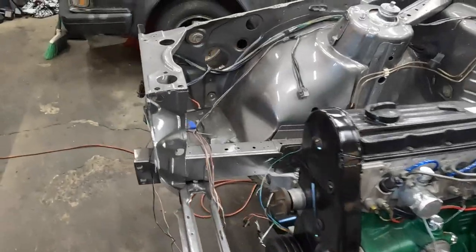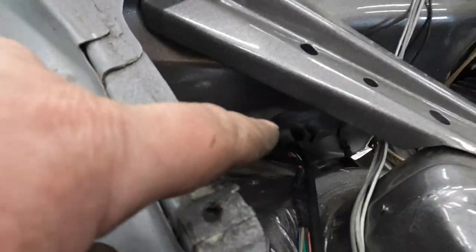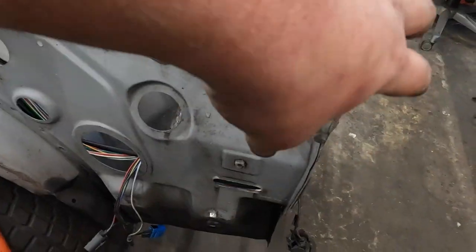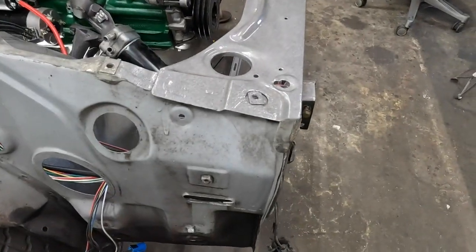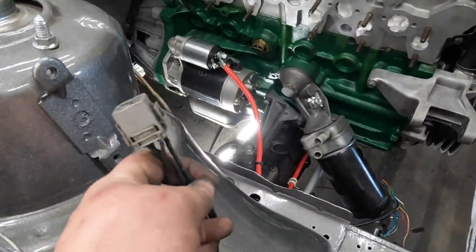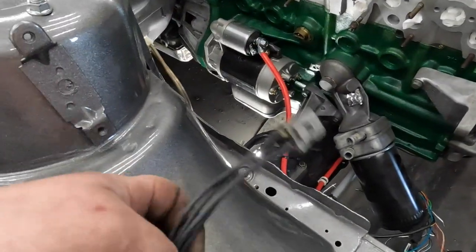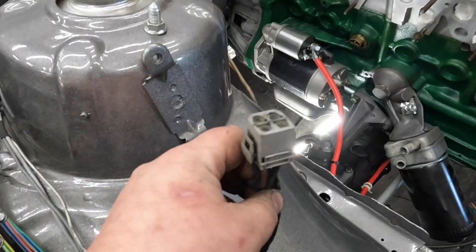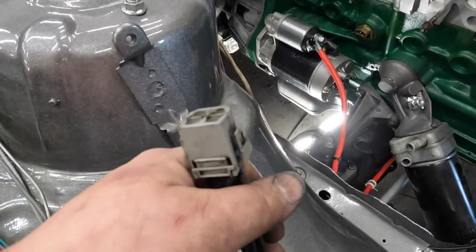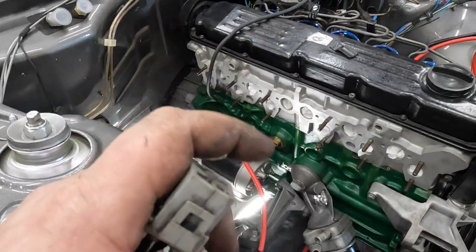The fourth harness — I can't count — uses another feed-through and comes up to give you your lights on this corner. Interesting note right here: what mounts right to the front of the coolant jug — on a gasser that would be the radio suppression relay. In a gasser with Bosch fuel injection, when those injectors are firing on and off they generate noise, a little bit of AC, and they move that relay out here so your head unit isn't picking up interference.